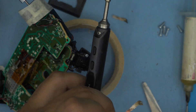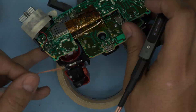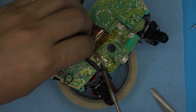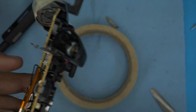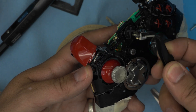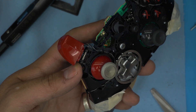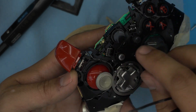I can see a good result right there — I'm holding the soldering iron there for about a few seconds. And that's it. Now once we did this, use a tweezer, flip it over, and pull out the old switch. This is the old one. Once you've got the old one out, grab the new one and put it right in place. There we go.